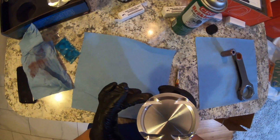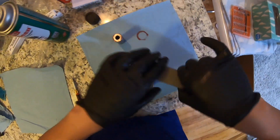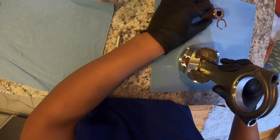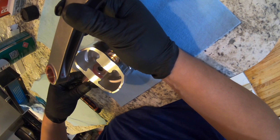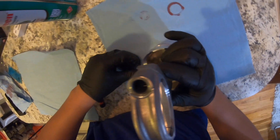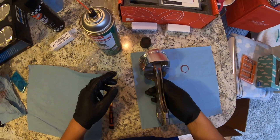When you look at this piston, the deeper grooves are the intake side. I'm putting the intake side on the front, and although these connecting rods are reversible, you want to make sure they're aligned the same way with each of the pistons and rods. Slowly slide in the wrist pin, place the connecting rod in, slide the wrist pin through the connecting rod and through the other end of the piston. And there we go.